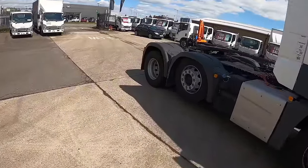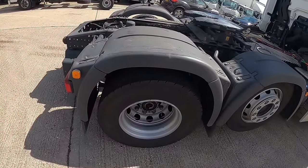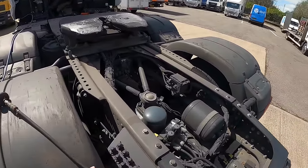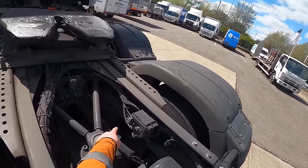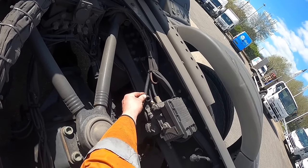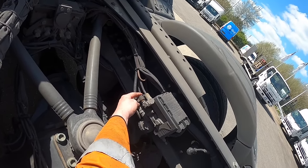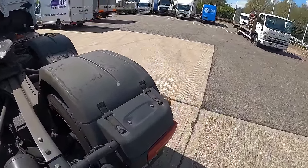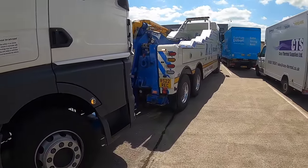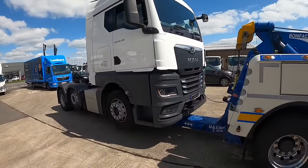We've got her in the dealership now. Just going to refit this half shaft — you see once you put a bit of rag in the hole it doesn't leak around the sides. This is a bank of air points. And over to my right I believe is the air point that bypasses electric handbrakes — if you put an airline into there, that knocks the handbrake off rather than taking it off manually like we did in the cab. Thanks very much for watching. Until next time, thank you.